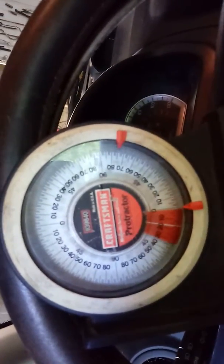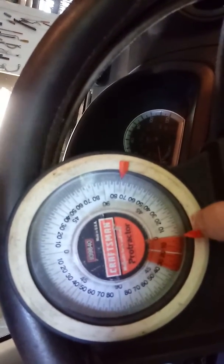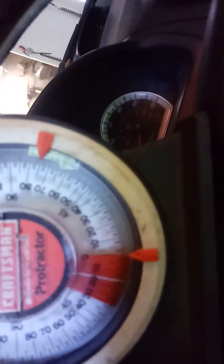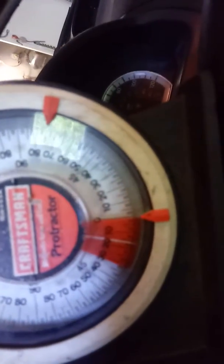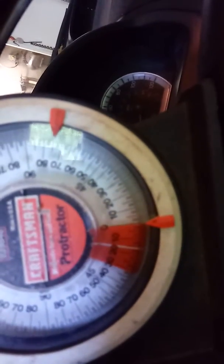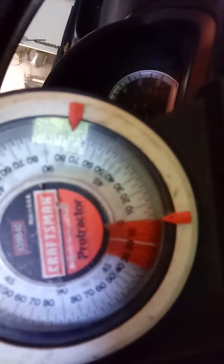But you want it with not the 3 o'clock arrow, but the 6 o'clock arrow. And with the white line on the gauge, line up where that 6 o'clock arrow, or pointer, is at 0 degrees straight up. That means your front end is in line by the steering wheel. You line the tires toe in, toe out from underneath at the inner tie rod end at the jam nut. But you don't do the jam nut till you're finished. That's how I do my DIY.